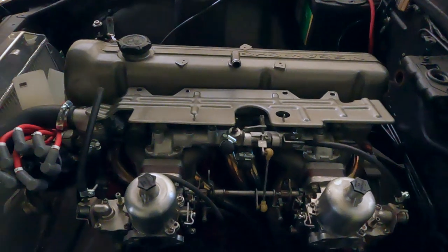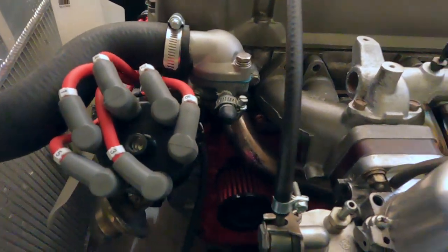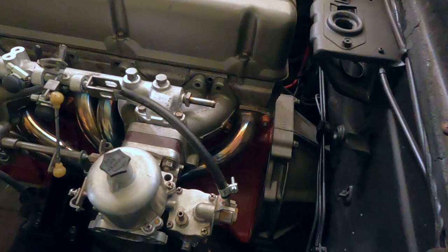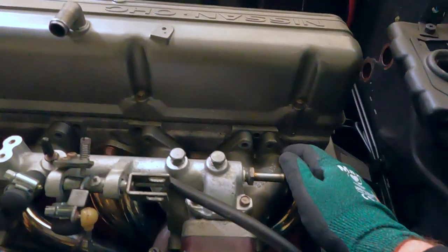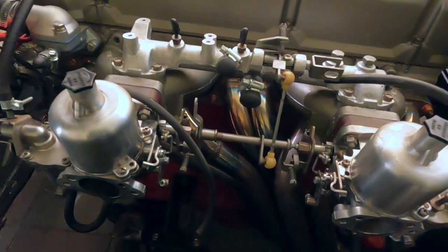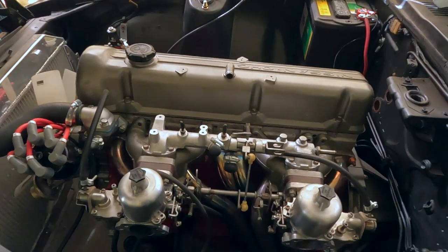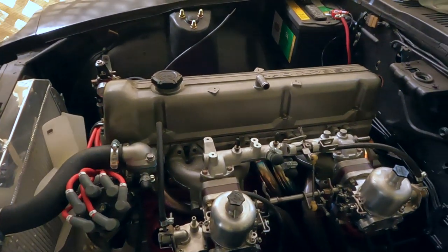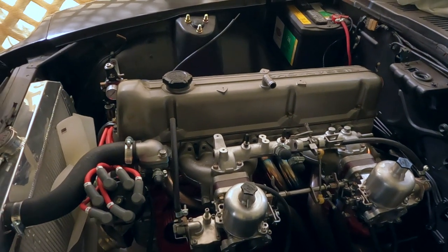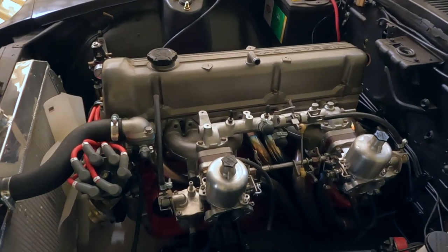So what I have done is taken off the heat shield. I've loosened up all the bolts that go around the header and the intake, taking those bolts off. The carb's still not coming off yet. I got a few more to squeeze in and take off, and then hopefully that should allow us to take it off. Start cleaning up a little bit. Like I said, touch up the areas that I want to touch up, and then hopefully work on getting the new carbs on.